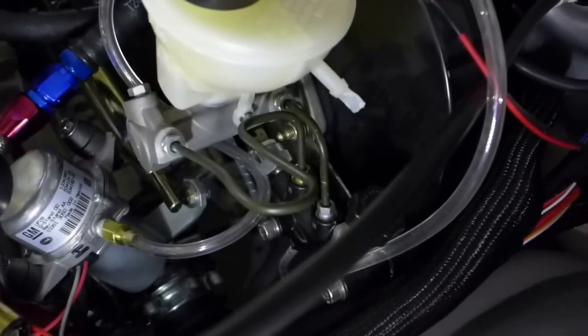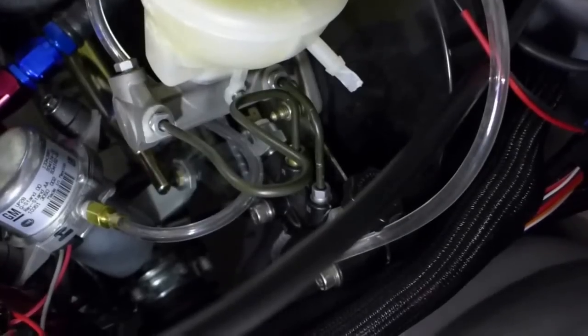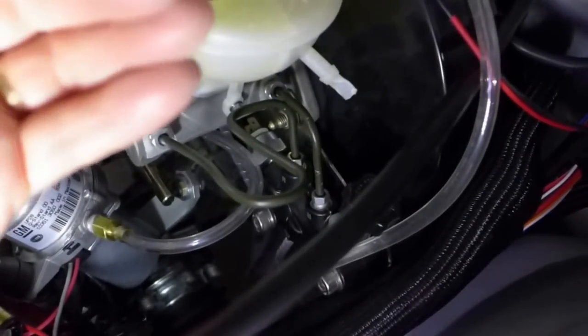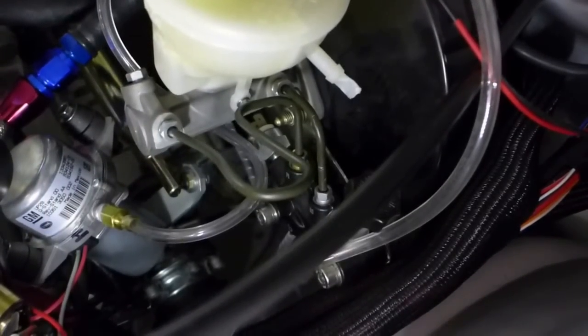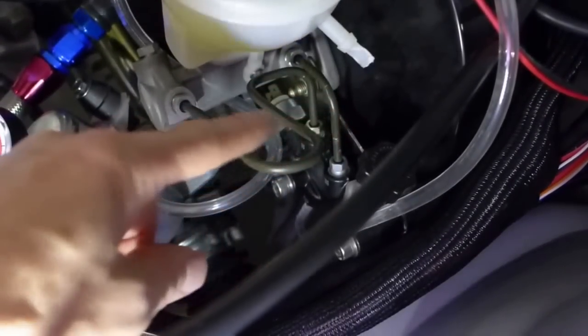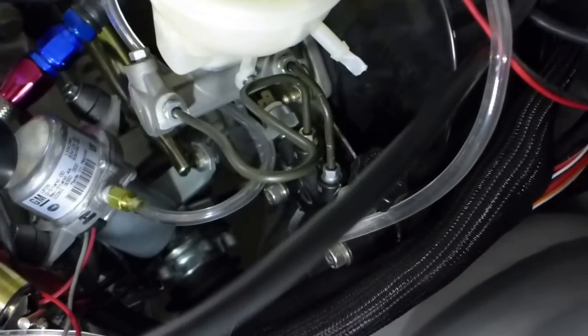All the bubble metric fittings were perfect. That one inverted flare — I think because originally when I tried to seat it, it was at a bit of an angle and I wasn't careful. No matter what I did, I had to bend a new line, made it a little longer, took a little tension out of it, and now it's in there solid.